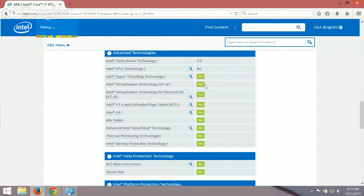Now if you do, the first thing you want to do is reboot the machine, go into the BIOS. The BIOS is a blue screen usually, and you can usually get into it using F1, F2, delete, F10 even. I've even seen escape. So just look for the way to get into the BIOS. You want to make sure that you have this virtualization technology turned on.